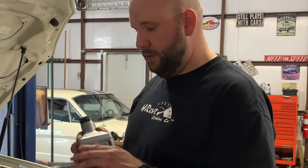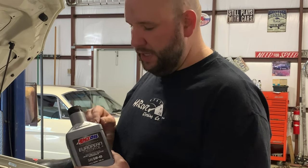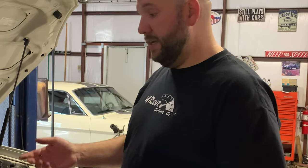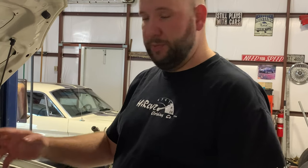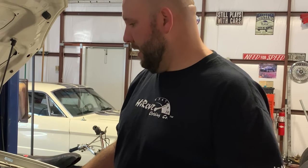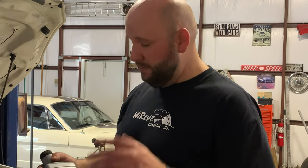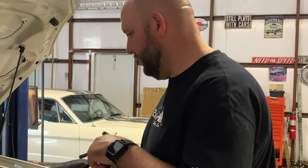I actually called our guys at AMSOIL, talked to one of the technicians, and he said that the reason they suggest 540 is because Hyundai has updated their specs on these engines, which makes sense because if y'all are watching this, you probably know a lot of these engines have problems with bearing failure, especially if you turn up the boost and do some things to them. So that's happened to multiple ones of them. So using 540, it might be a pretty good idea. Using 100% synthetic AMSOIL is hard to beat that way. So we will get some added to it here.